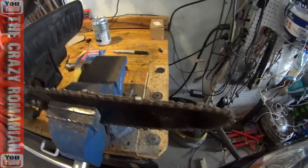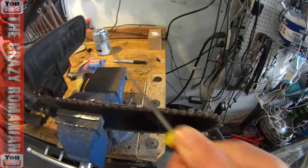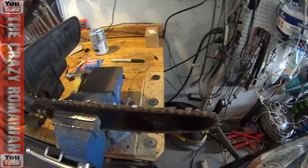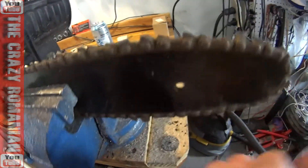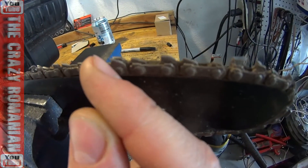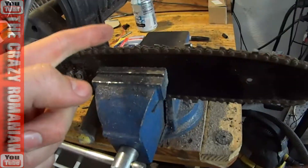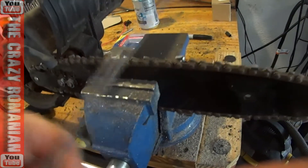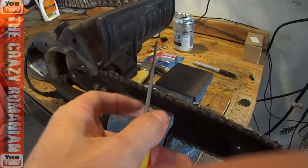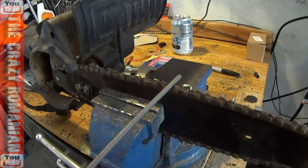Right now I'm going to sharpen this one again — just bite against the tooth. What you're going to do is create an edge on one side that's going to bite really, really well, and also an edge on the top part which is going to bite very well. And if you have a cheap chainsaw and you're complaining that I'm sharpening it the wrong way and going to destroy the chain —